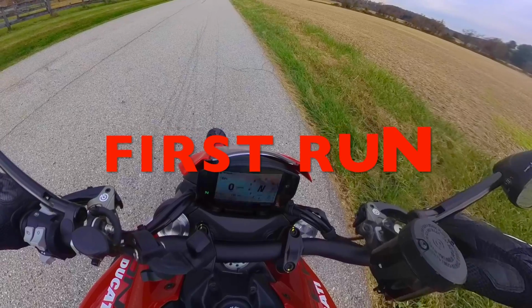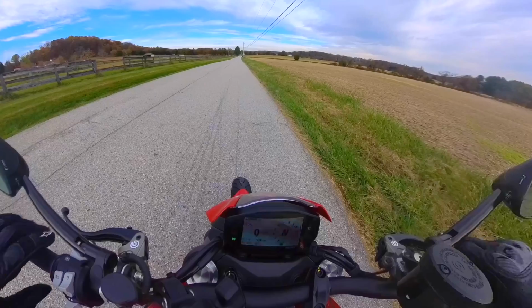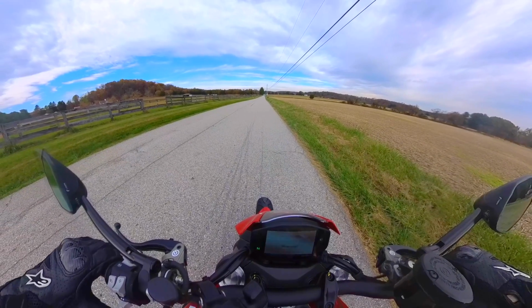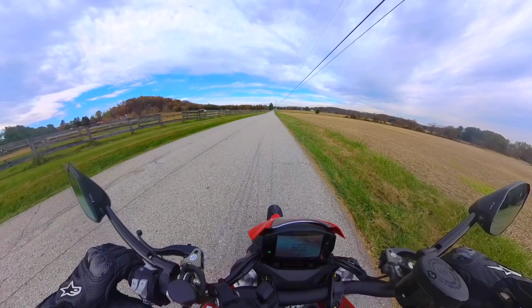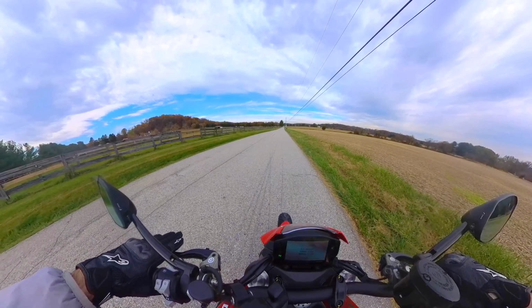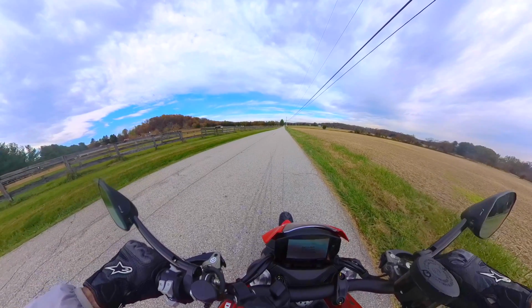All right, let's start this up. So, again, we enter DPL from the menu, we go up to level 3, we hold the button down, and then it says, pull the clutch, engage first gear, and open full throttle. So clutch, first gear.